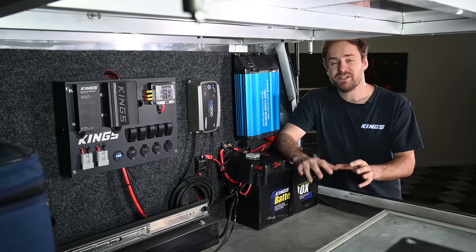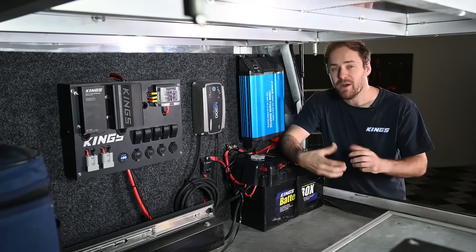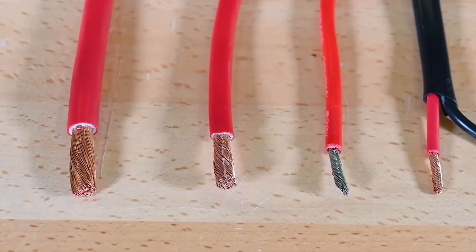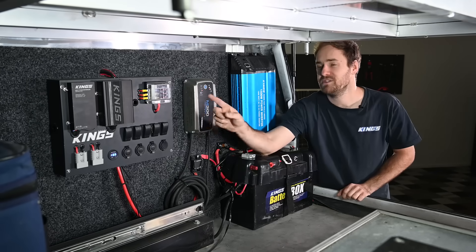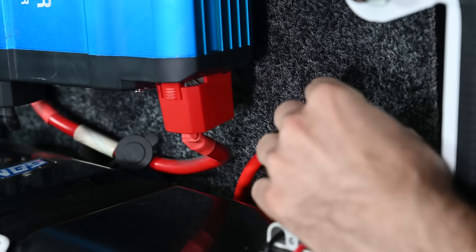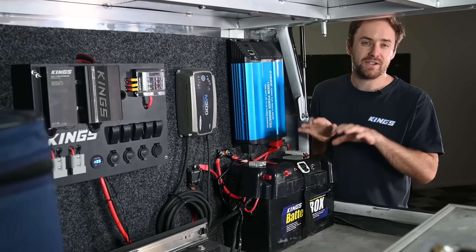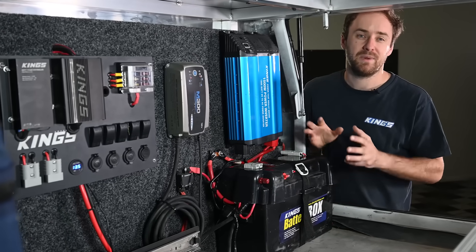There are three easy ways to ensure that the system is robust enough to handle heaps of 12 volt gear or plenty of power hungry gear. The first is to make sure that your power cables are big enough in diameter — there's a link in the description with some basics on that. Second, you can make your own power distribution box, but ensure that you're using fuses or circuit breakers as close as possible to the battery so that if anything goes wrong they'll pop instead of causing a short. Third, if you are planning to use a lot of power hungry accessories, a good investment is to run two deep cycle batteries — that means you'll have double usable capacity, plenty of storage and plenty of power to go around.